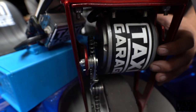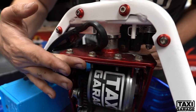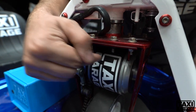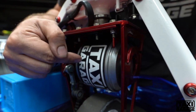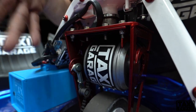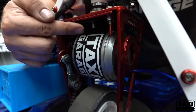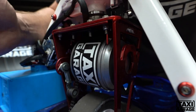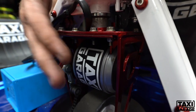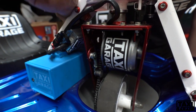On my personal cart I've added some outer bolts to strengthen the under-motor support plate. I want to emphasize that each one of these necks is built by hand and matched to every individual motor, because these motors do vary in their top motor plate angle. We pay extreme attention to that since it affects performance. There's a support plate here that supports the motor and keeps it from torquing. This also addresses a common problem on the XL: the XL neck's motor will twist and start throwing chains. We have a bolt-on product on our website that fixes that.